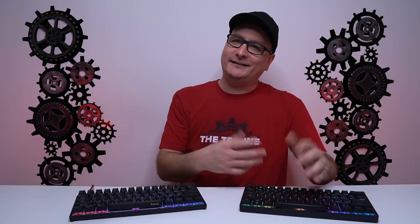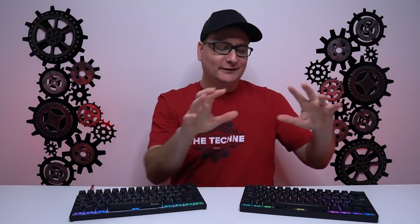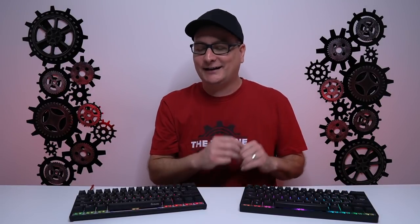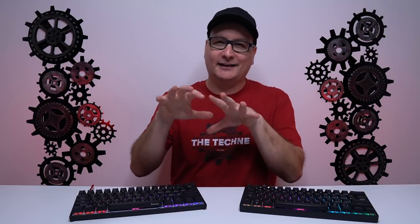After the sound test, both keyboards sound incredibly solid, though they do sound different — basic Cherry MX Reds on the Ducky versus Silent switches on the Venus. Underneath the Venus there's also a cloth sound dampener, which would really help with louder switches like blues or browns to reduce any ping or tinny sound. The Ducky Mecha Mini is louder because the floating key design lets sound radiate out freely with nothing dampening it.